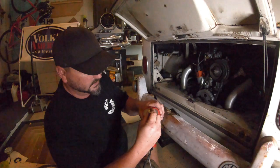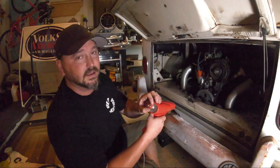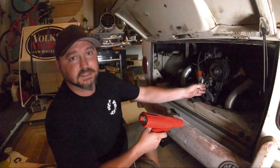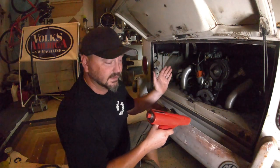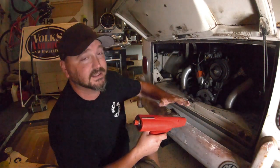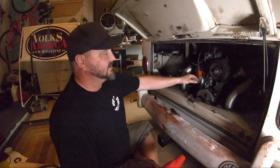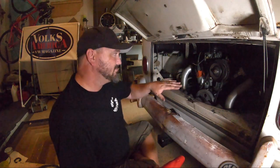With the motor running — moving the dial to zero shows your actual timing, which was around nine or ten degrees at idle. Move it up and pull the trigger to verify top dead center, then rev it to where it completely stops advancing. It was 28 for me — that's where I like my maximum advance. Some people say 009s should always run at 32 for maximum performance, but it just seems to run a little hotter for me, so I dial it back.